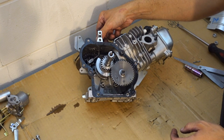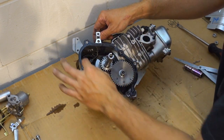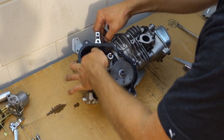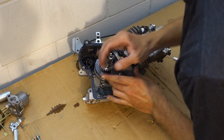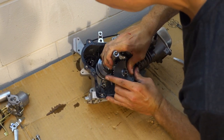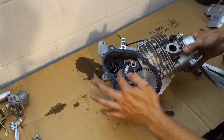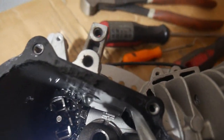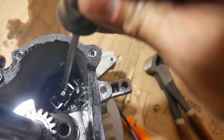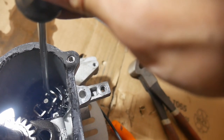On the 79cc engine there's a little clip here from the governor piece that comes to the top of the case. You can drop that clip loose and then, if we turn our engine to the right position, we should be able to get that out of there. Your governor is right back here, and I want to show you how you can defeat these governor systems. There is a little circular clip on this rod that holds it all together, and there is a break in that circular clip.